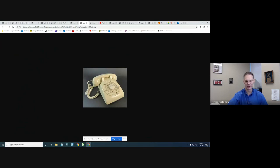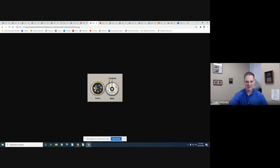Well, you also saw it for over 100 years. I think I mentioned this earlier. If you look in phones from the 1970s, and this one's from the 80s. This is, I think, a Bell South phone that they would rent to you before Ma Bell got broken up many, many years ago. But this is back in the 80s. I think this was like 1985, 84, something like that. Right here is the receiver. You listen in this, but right here is the microphone for that telephone. If you crack this thing open, inside you'll see this little thing. And this is a carbon microphone.